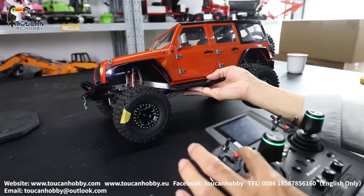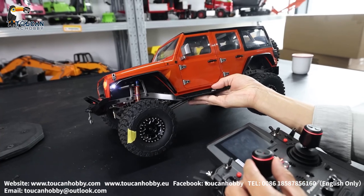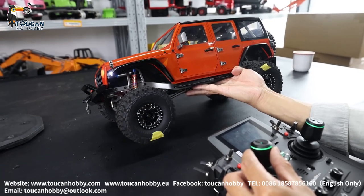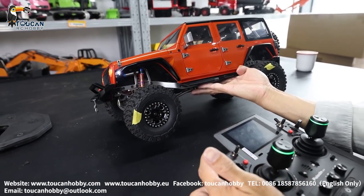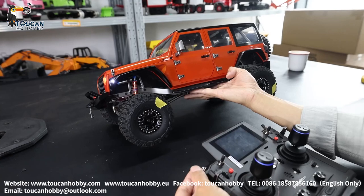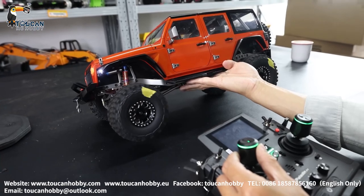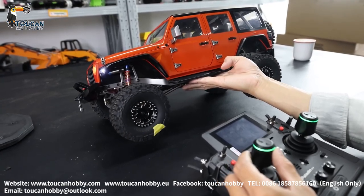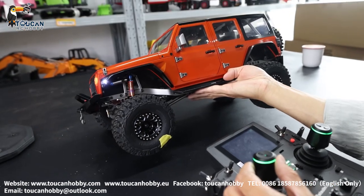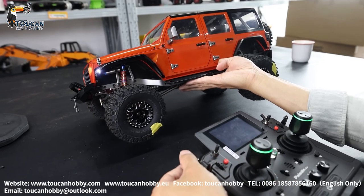Differential unlocked — let's see the forward driver. Now it is at front drive, so the rear side still has power from the gear resistance. Push it a little — it will stop. Now it's front driving. Pushing to middle position — 4-wheel drive. Pushing to backward — that's rear drive. Front is completely cut out, front has no power. Changing back to 4-drive.